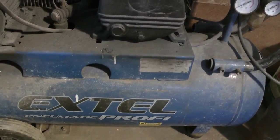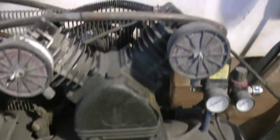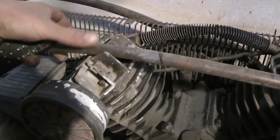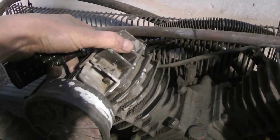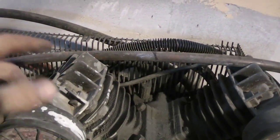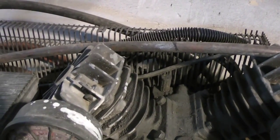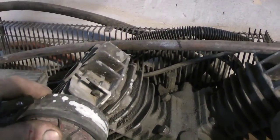It has recently started taking longer to pump, although I cleaned it. Under the cap, remove the four bolts — there are two plates, the valves. Take them off and clean those plates with a thinner, by no means with abrasive paper. Put it back, reassemble, and the compressor unit comes back to life.